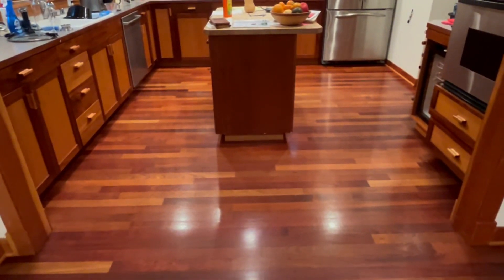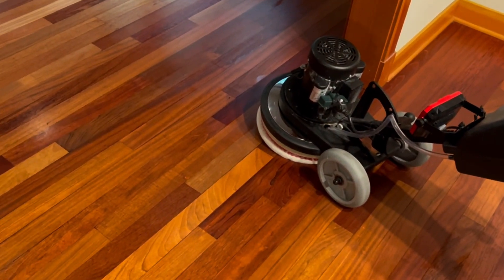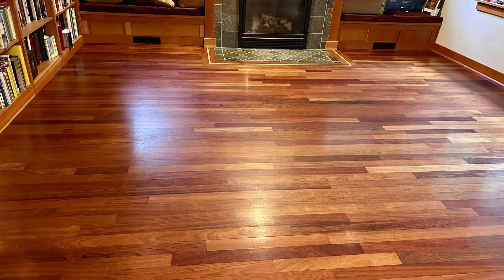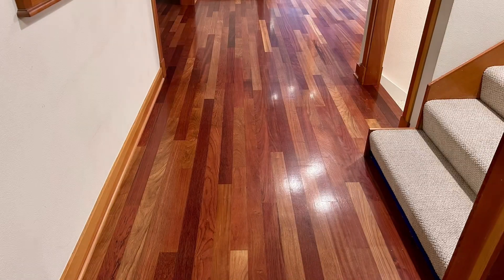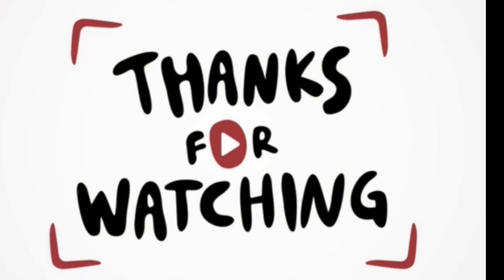You can see right where I stopped — the dullness from the lights versus the bright shine, how it's popping over there. If you just go over it with a white pad, it's going to clean it up but it's going to look dull like this. So here we go through and do this one, let it dry. There's the white 3M synthetic pad. And I'll show you some after pictures. Hope this was helpful to somebody — look how beautiful it came out. All that wax and garbage is removed. Or if you're watching and you have that problem, give us a call. Thanks for watching, and I'll see you in the next one.